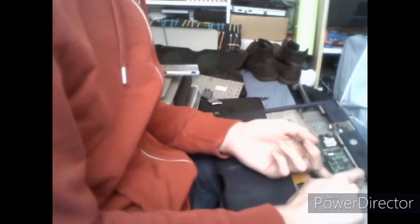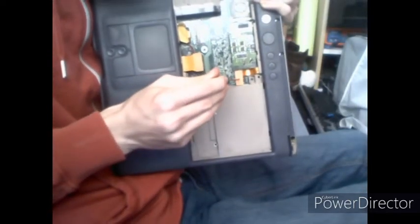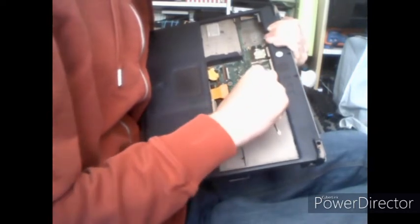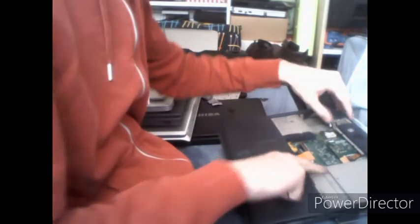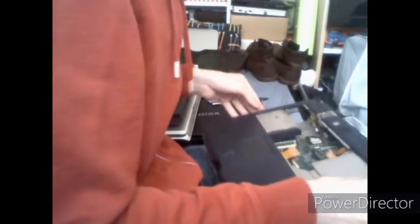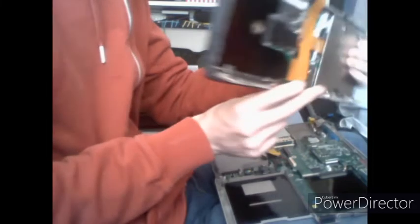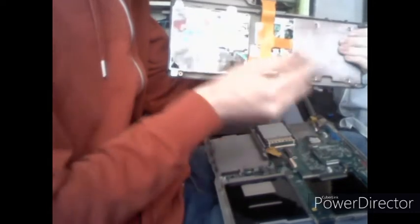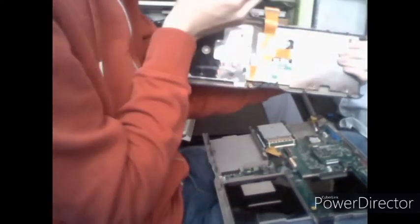Then there's another connector just down here, which is this connector right here. It's another one of those Lego connectors, so you just pull up on it to get it out, and then the rest of the top half will come out, which will also be useful if you're replacing the belt in the floppy disk drive or doing any work on the palm rest or speaker assembly. It's a very helpful